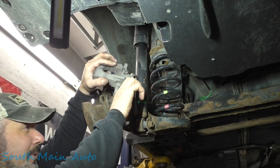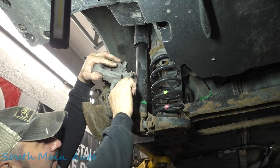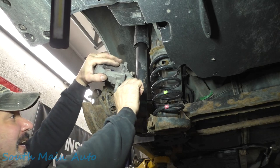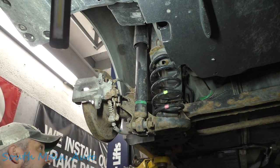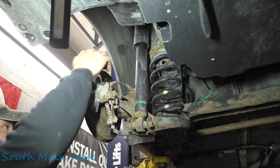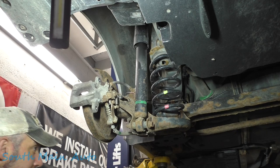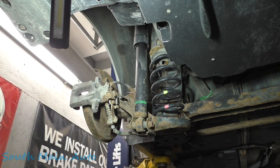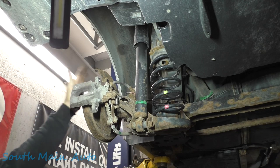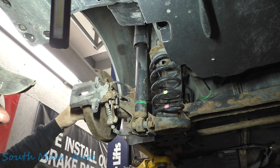Last but not least, I want to make sure that our parking brake works here. Yeah, I see the piston popping in and out. I checked that side over there, that side works good. The only other thing I see is the two rear brake lines that go to these flex hoses are about a pedal pump from popping. They're about as big around as my thumb and super rusty. So I'm going to suggest that they do both those rear. I don't want to touch it because it's going to break. But both those two short sections of brake line, pads, rotors, I would definitely recommend doing both bearings